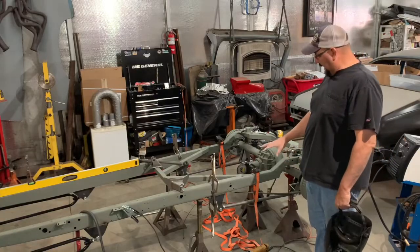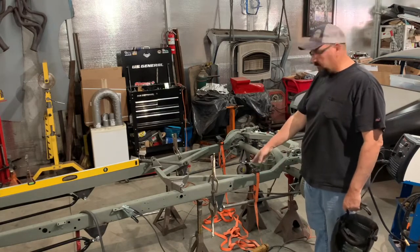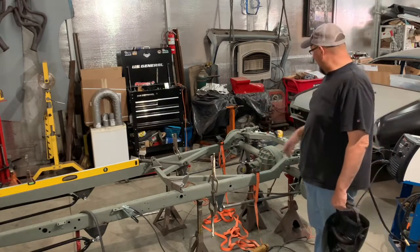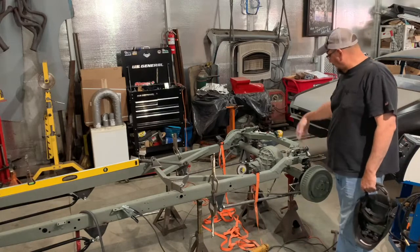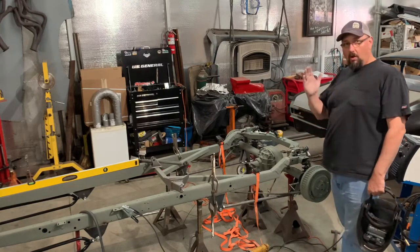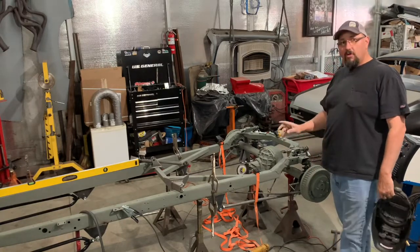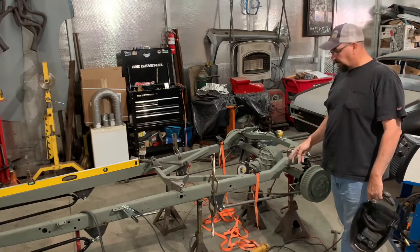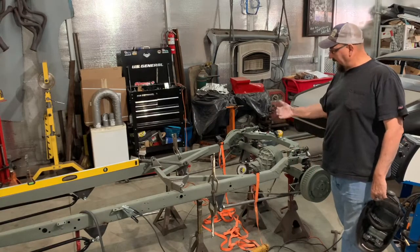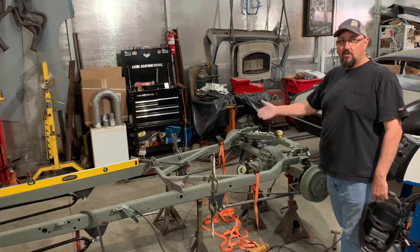All right, I got everything clamped in place. I pulled measurements from the front to my brackets, both sides. I've squared the rear end side to side, front to back. Got my coilover angle set where I wanted it. So I'm gonna start tacking everything in place. When I get this tacked and the rear end tacked, I'm gonna cut the two bars out and start with the upper.